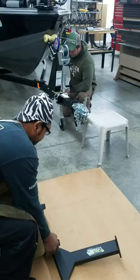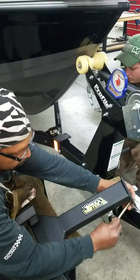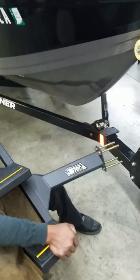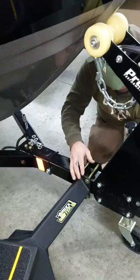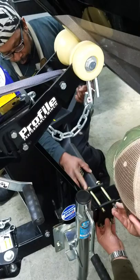If you've got two guys, it's easy. One guy can do it. I've installed plenty of these steps by myself, but when you're lining up the coupler plate on the back, first stick all four bolts in the coupler. You can move it on this installation — you don't have room to go up and down, but you've got room to go back and forth. We're going to put it about a half inch behind the winch post and it will clamp right around that. We send two silver nuts in the package that are just stock, easy nuts that you can run on all the way with your finger — you don't have to fight a lock nut.